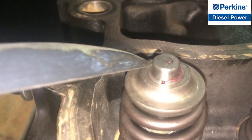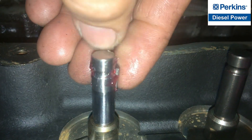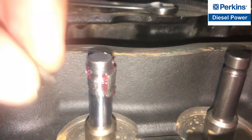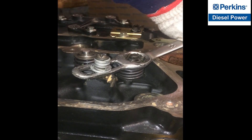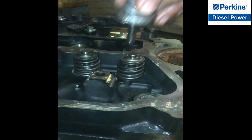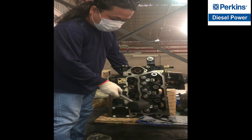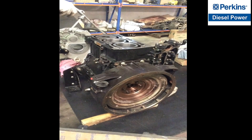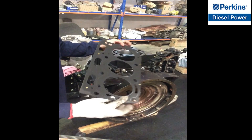So this is how it looks — the valve locks right here in the valve lock groove, as you can see. The valve locks are embracing the valve stem, just like that. Continue the process of assembling the components of the cylinder head. Lastly, tap both intake and exhaust valves to make sure that all of these are totally secured and fitted.